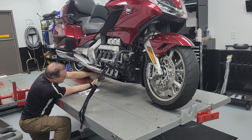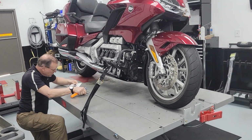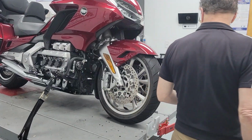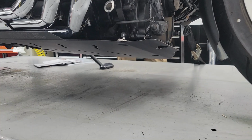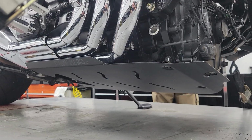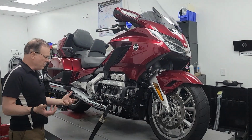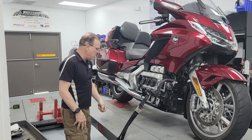They have a nylock nut on the rear here, which is something I like. So that's it. It's installed. Important thing to note, all of the belly pan design ones require you to have the bike on the side stand. You can't put this on a center stand because you cannot get the T-bolt that goes up into the frame on. So that's why this bike's on the side stand. Next is just my push, pull, and smack test, just to get an impression of it.